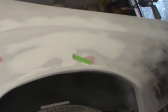This part, I could keep sanding. I know that's low, and you could sand it all out, and you could ripple the whole quarter panel. There's no sense sanding the whole thing out, because there's no guarantee that's coming out. No guarantee. It could, but I'm not trying to break into the 7 deadly sins here, because once I hit the red on this car, that tells me that's metal to me. I make that up. I don't want to go below that red. I'd rather just keep filling. Normally I don't want to fill, but I do not want to break into that red in those quarters.